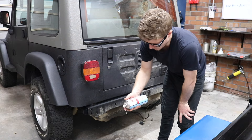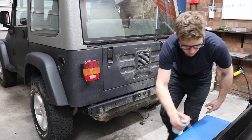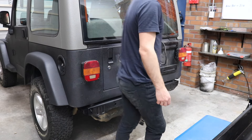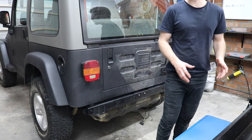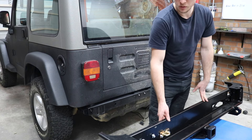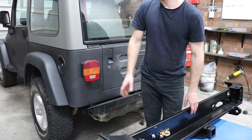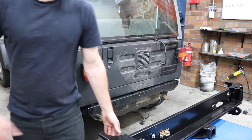We'll bring the rear bar over now. I'm going to spray some Inox on the positions where it'll be metal-to-metal contact — it'll help slide it on and help with any rust in the future. I'm adding up all the weight of the rear bar to see how much it's going to load up the car compared to the old stuff. Just this rear bar weighs 31.6 kilos, so it is going to be a very heavy kit. All up I'm expecting around 60 kilos, though keep in mind we removed probably around 25 kilos.